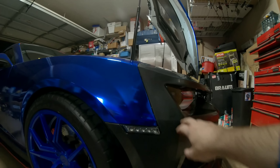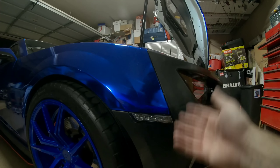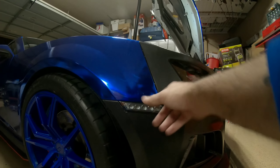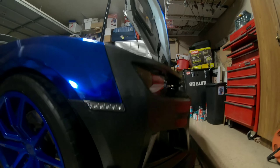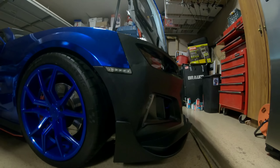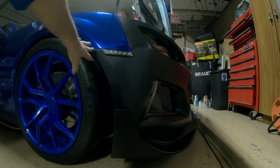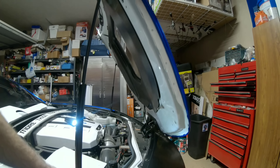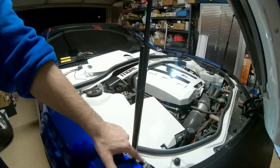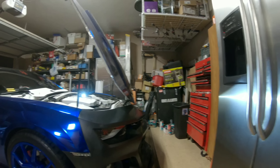The reason is this material is polyurethane, and when you put the screw through you don't want to over-tighten it because you're just gonna start eating away at the material and then it's not gonna hold up. My recommendation: make sure the screw on the side goes in first — that's gonna be your support to push this back. Then use the clips right here as support along with the clips under the hood, and once those are all in place it pops right in.